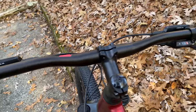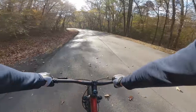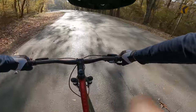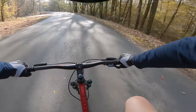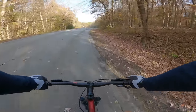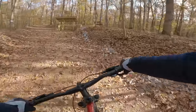The question is: with a 15 and a quarter inch frame, can I ride this thing? Before I get going on the trail, I want to mention — when I pay more for a bike I expect it to be better tuned out of the box. How was the Dakari shifting? I had to make a single micro adjustment of the shifter's barrel adjuster; from there it dialed right in, easy to shift through all gears. Braking worked out of the box — I did need to adjust the throw on the right lever, but a slight twist of that red knob and the brake levers engaged equally. That quick, and the bike's ready for the trail.